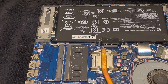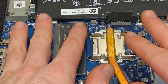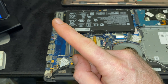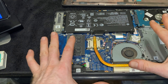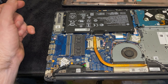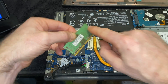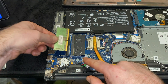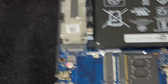Let's get to the RAM chip right here. This is like the best computer I've ever worked on because you don't have to flip up the motherboard. We already have a RAM chip in here and we're going to add a second one. They're pretty easy — you can see there are two cutouts on the chip, that's where the two pieces will clip in, and there's a divider on the chip. Let's look real close at where the divider is.